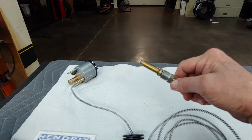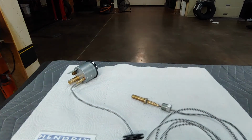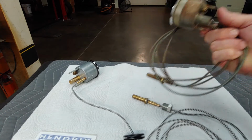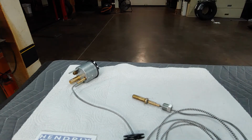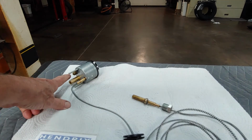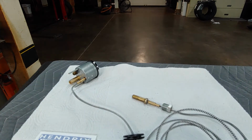So those are the two problems, getting this to fit, to replace the original here that did fit. That's how to make that fit. Now that you got it fitting, you got a leather washer that'll fit that because you took the new ones and you made the hole bigger by burning it in. We're ready to find out, is this thing accurate? So we're gonna now move to some boiling water and see what we got.